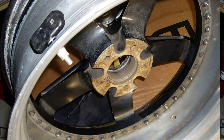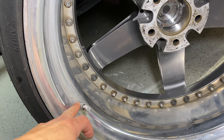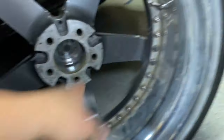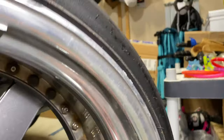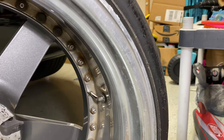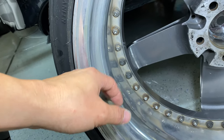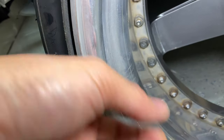I've got them mounted now on the inside barrel. I actually drilled this hole back in 2010, about 10 years ago, when I was rebuilding these wheels. Originally I had them strapped inside with big hose clamps, but they kept falling out. I tried a screw through the back side too, but it kept breaking — guys at the tire shop always over-tightened them. Eventually I said forget it. My friends in the tire and wheel business, even the guys building wheels down in Miami, they just drilled the barrel, so that's what I did.